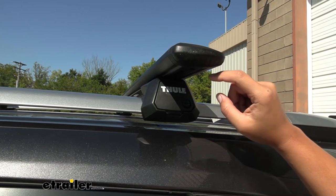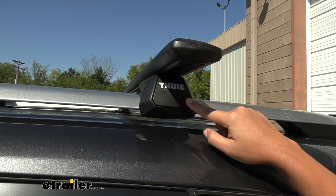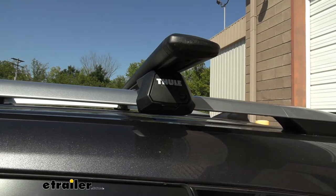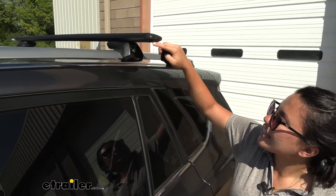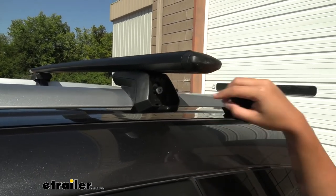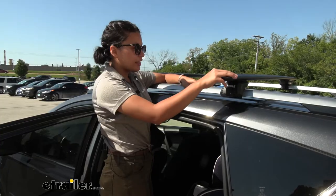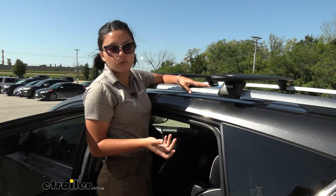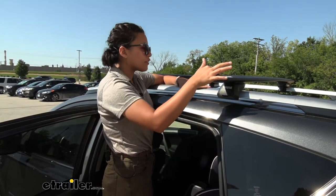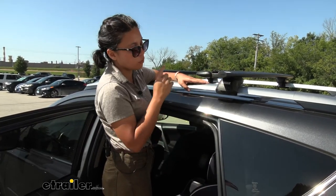The tower has an end cap — it comes with a plastic lock core, but you can switch them out for Thule metal lock cores. Just make sure to get a whole batch so you can key them all alike. Pop that open and you get easy access to your towers, and there's an included wrench with a torque spec of 4 Newton meters to make sure it's secure on your raised rails. These are aero bars, meaning they have less wind drag and wind noise compared to round and square crossbars. There's an opening on the inside for your T-track mounted accessories — just flip the cap open to access them.